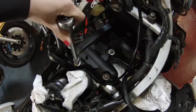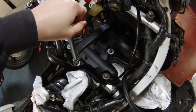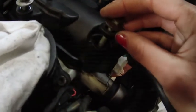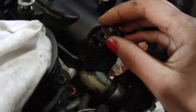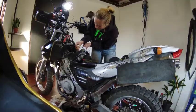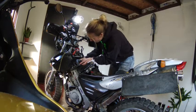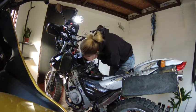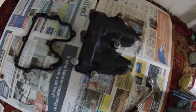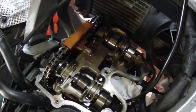I'm now going to begin unscrewing the bolts from the valve cover, doing this in a crisscross pattern as I go. I'm just going to unscrew the last little bit by hand — the Haynes manual does say to check these rubber washers and to replace them if necessary. The valve cover has now been successfully removed, and this is what it looks like inside the engine.